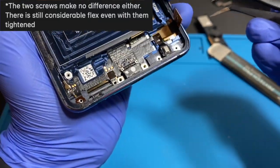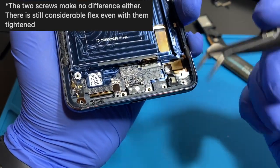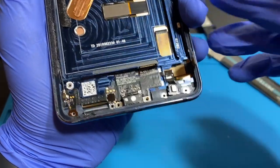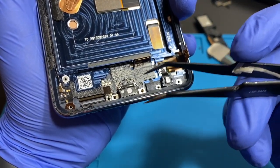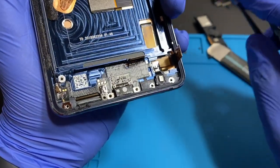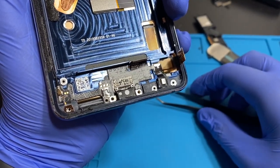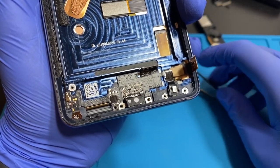Come on, is this what Nokia has become? Designing ports like this? This is crap design. That's pretty disappointing. Nokia has been going down the gutter pretty fast recently, so not surprising. I'm going to think about how to fix this. We could solder it, but I don't have a micro tip — my soldering tip is literally bigger than those pins. It's just going to spray all over the place, contact the resistors, and be a mess. So I've got to think of something. If not, we're just going to charge this thing wirelessly.